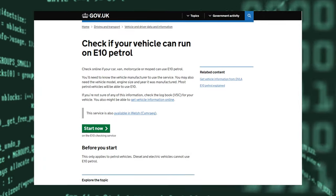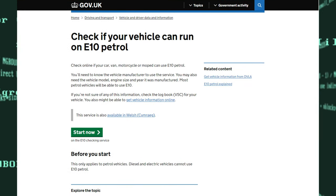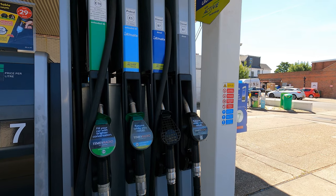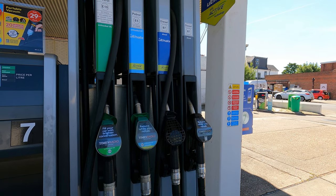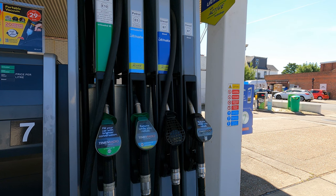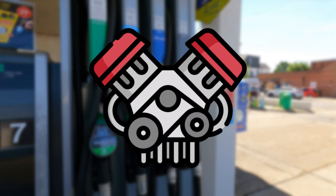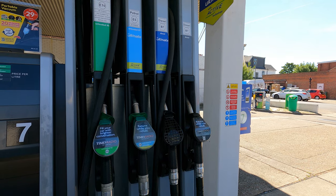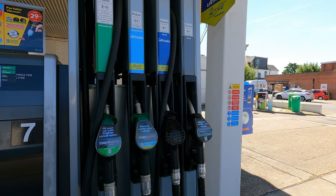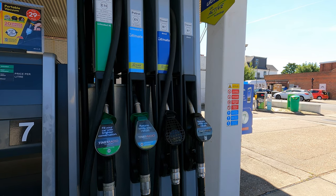There's also a website you can use to check — I'll leave a link in the description. E5 is a premium unleaded fuel. There's also a premium or super diesel fuel which is normally more expensive and with ongoing use claims to clean your engine, improve your car's performance and help it run at its most efficient. If you put in the premium fuel by accident then you might hurt your wallet but you won't hurt your car.